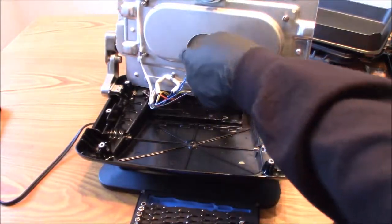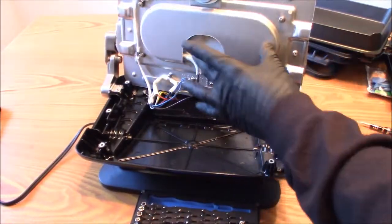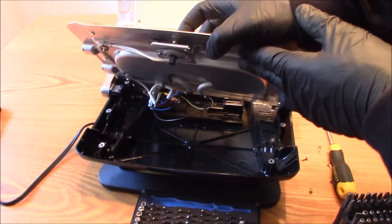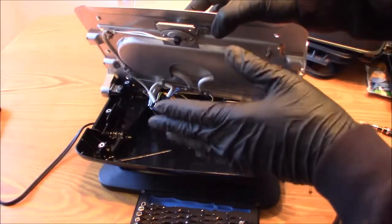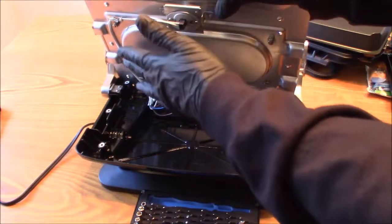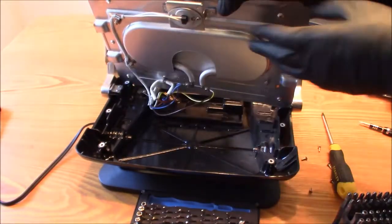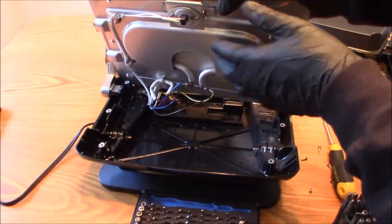This is a metal coil. It coils around. And it's just a heating coil that heats the plate up to a certain temperature. And then this is like a safety switch here. It'll engage when you close it, and this will open up power that goes through your unit here. If that's not down, it won't send power through the unit, so it won't come on. But this is a safety switch here. When it's engaged, power goes through.